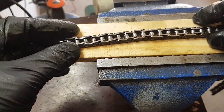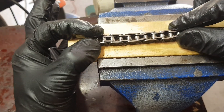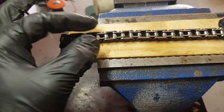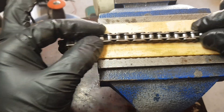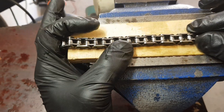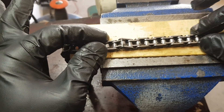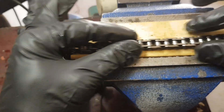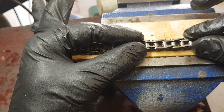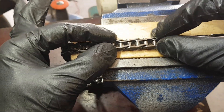The problem was a lubrication issue over an extended period — meaning oil was not replaced according to service intervals. In addition, we found an injector gas leak creating carbon, which partly clogged the strainer. This engine was introduced in 2012 and manufactured without modifications until 2013. This vehicle came to the workshop with an oil pressure warning and error code P0524, meaning low oil pressure. The customer was repeatedly warned by a message on the display, but unfortunately this was ignored, leading to engine failure.